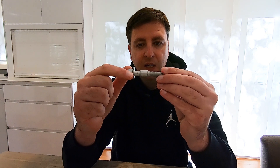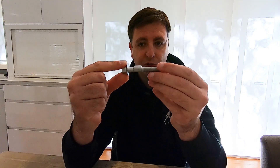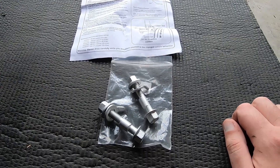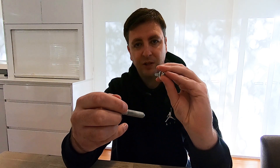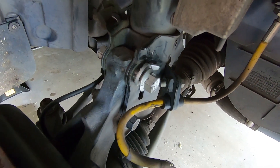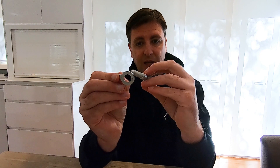As you can probably see, it's offset — the shaft and the thread are not actually centralized to the head — so when you turn it you get a bit of movement. It's also got what is essentially a cam lobe on the bolt, and that's where you get most of your adjustment. To fit them you have these locking tabs. For negative camber you want it to point to the inside of the car; for positive camber you want it to point to the outside. If you hold that and just turn it, you can see the head of the bolt actually moves inwards, as does the cam. That offset shaft comes into play with your locking bolt, which locks into the existing hole where the existing bolt is and helps with the movement.